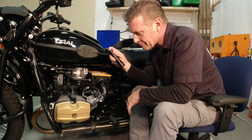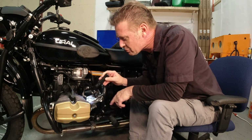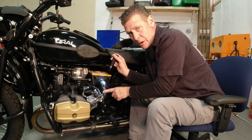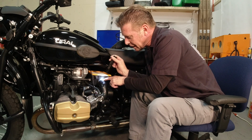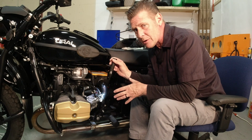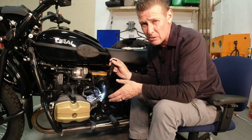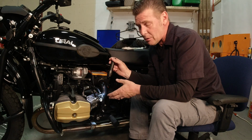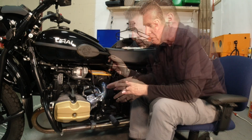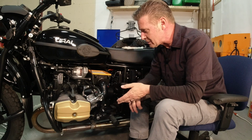while you're at this point, you might also want to get some good lighting and inspect the branch pipes. You can look around the clamps and around the connection points, particularly if you live in a warm climate where it dries out rubber components, or someplace where they use a lot of salt on the roads that can corrode clamps or degrade rubber components. Any of those things that look like they've deteriorated a little bit, you're going to want to replace those.